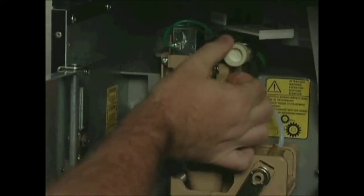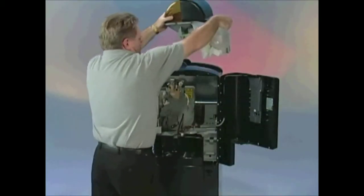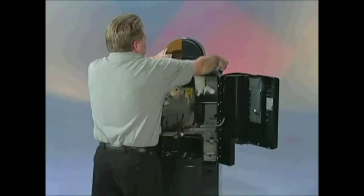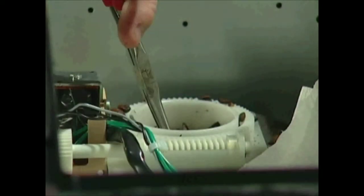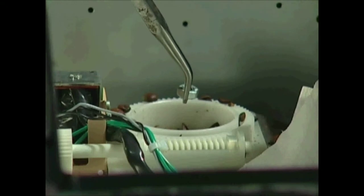In the event of a grinder jam, power the machine down and remove the bean hopper. Take special care to make sure the bottom slide of the hopper is closed before attempting to remove it. After the hopper is removed, begin to remove the beans from the throat of the grinder. Examine the grinder to determine what caused the jam.